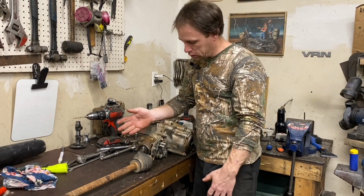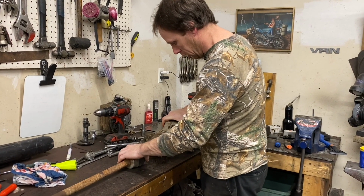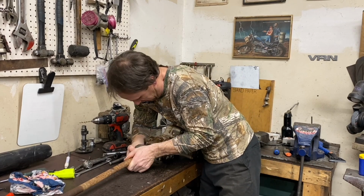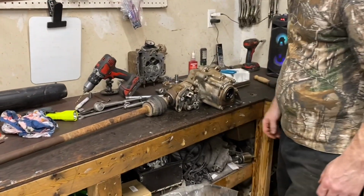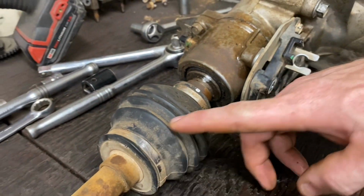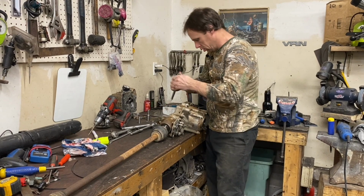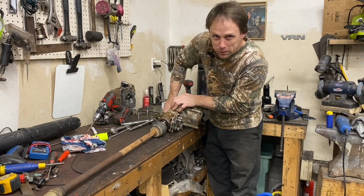Be nice if they said why in the instructions not to take it off. It's a pretty straightforward thing. That's it. There's no O-ring there, so I just gave it a little pull to get it on the O-ring. This looks like a CV joint, but it's really just a U joint inside that boot. The drive shaft also didn't say anything about marking the other end, or who knows what they're thinking, I guess. Let us know in the comments, I guess.